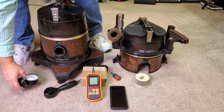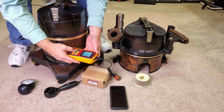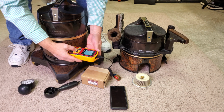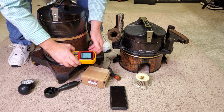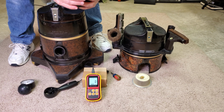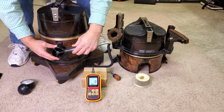Okay. The suction gauge says 62, and that might be the highest number I've ever tested. Let's see, I'm gonna get feet per minute, and then get the maximum, okay. Hopefully you can see that. Got my calculator here to convert it. I don't bring this gauge out all that often anymore because I have my other one. And the reason why I bring this out is because this vane perfectly fits this opening. I mean, it's just perfect.